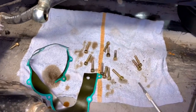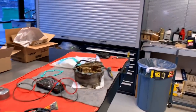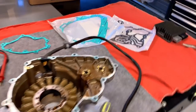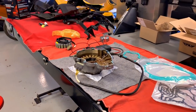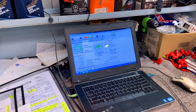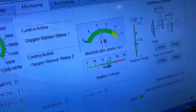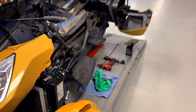She's out — I just gotta swap the stator around. There's a little something over there that needs to be ridden — here's the key to it, something brand new. I'll try to get a ride in on that before the rain comes. The screen is really blue because I have my white balance locked — but that's what you want to see right there: charging 14 volts just sitting here idling.